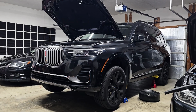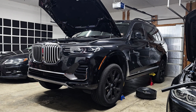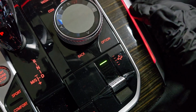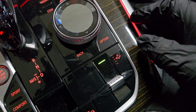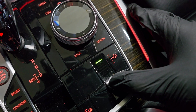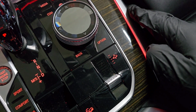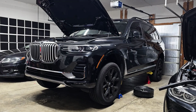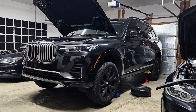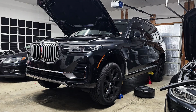So once you've got enough space under the car, we are ready to get under and do the rest of the service. Now, of course, before you jack up your car, if it does have air suspension, make sure you disable that from inside of the car. The process is super easy. You go into the dash where it has the little indicator for the ride height of the vehicle, and you're going to hold the button either up or down for 7 seconds and then let it go. If you don't release it after 7 seconds, it won't work. It won't automatically turn off after 7 seconds. You have to let go of the button, and you should see the little green line go away, and that way you know that the air suspension is disabled, and that will allow you to jack it up in the air without creating any errors with the ride level system or anything like that.